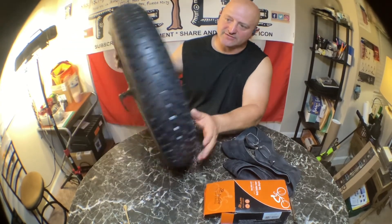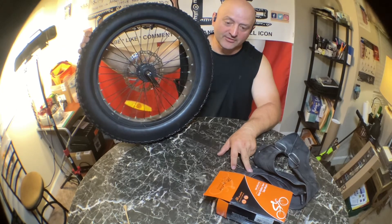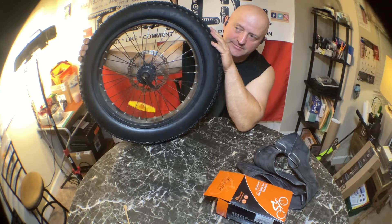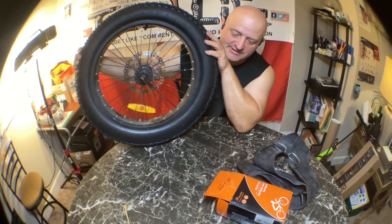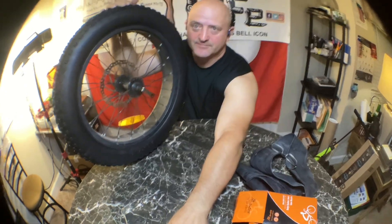That was a changeover in less than 10 minutes. So if you have these spoons and an inner tube you could literally be back on the road within 10 minutes. I might take that inner tube with me and make a little kit, so that way if I blow a front tire I'm covered. Now the back tire I'm not too sure about because that's where the motor is — you might have to disconnect a wire and pull it off. But as far as the front goes, this Rad Mini — 10 minutes and you're up and ready as long as you have all your stuff with you. Anyway, this is Roger with Roger's Reviews — how to change out a tube and tire in less than 10 minutes on a Rad Mini or any electric bike front tire. See you later!